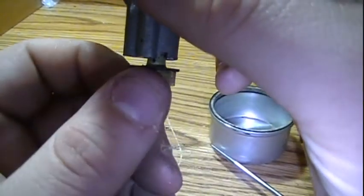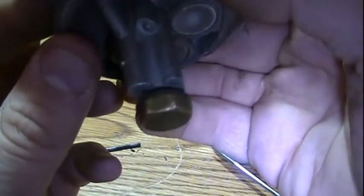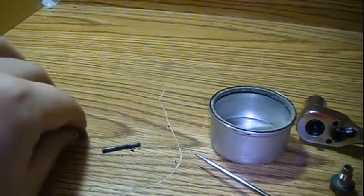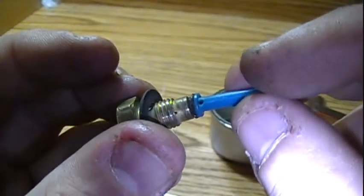What I was talking about before was this bowl nut acting as a jet. The way that this acts as a jet is because you can see that passageway — the fuel would go through there and go up into the emulsion tube, which you can see in there — that little bluish color pipe. If we want to take out the emulsion tube, we can simply press it out with a flathead screwdriver, give it a good tap, and out comes the emulsion tube. You can see how it corresponds to the bowl nut, because those two fit together. There's an O-ring around here, and those two work together.